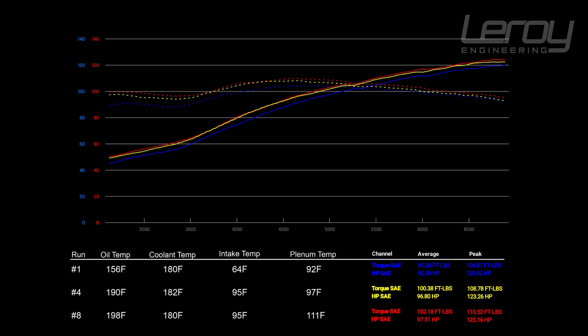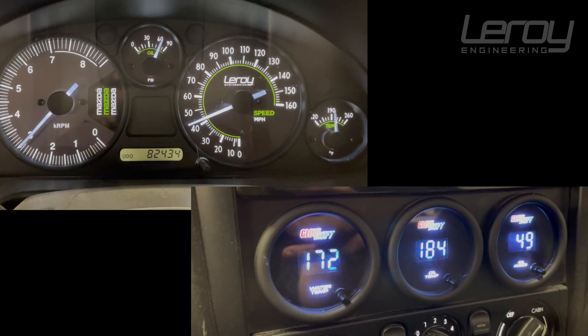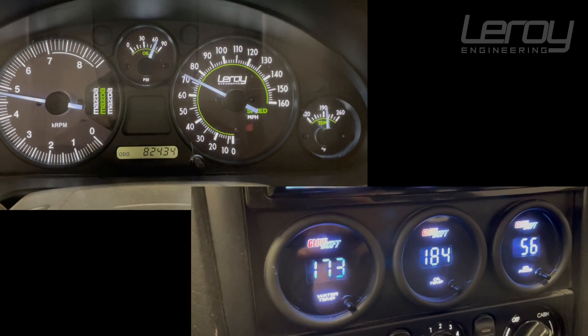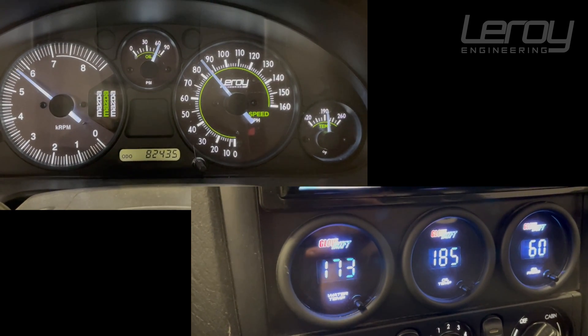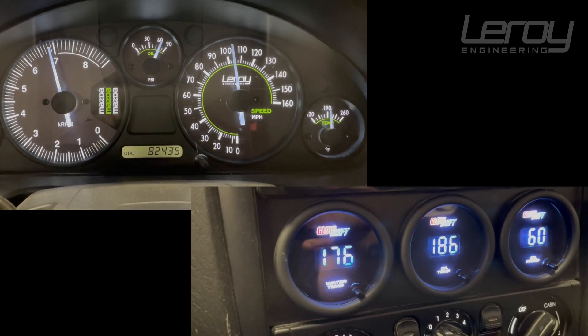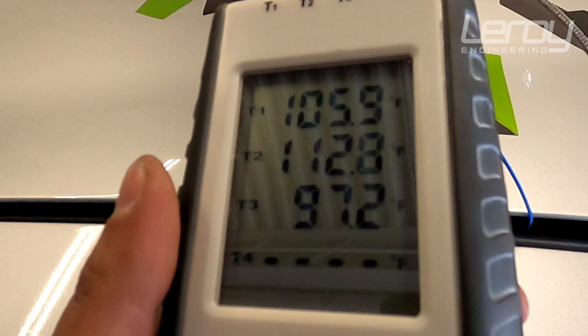Now this is backwards of what the internet says — as all of our temperatures got hotter and hotter, we kept making more power. Look at the oil temp. As oil gets hot, it thins out and takes less energy to rotate and pump it. So what we're seeing here is not that hot air makes more power. What we're seeing is that the losses due to cold oil are higher than the losses due to hot air. And since it's tough to get really cold air while maintaining really hot oil, this is going to be a real world trend. Does this mean air temperature doesn't matter? No — obviously cold air is denser, but on a naturally aspirated car, the density change between 60 and 90 degrees is not extreme. On boosted applications, compressing the air and then heating it with the turbo can get you up to 200 degree intake air and the horsepower plummets — so a big intercooler helps make power again. But on a naturally aspirated car, the delta is just not there.